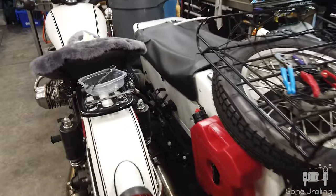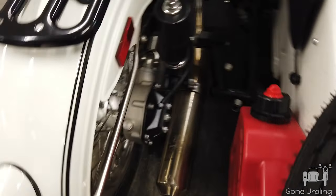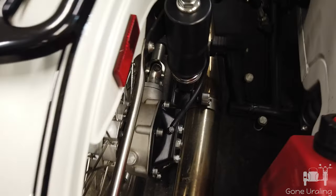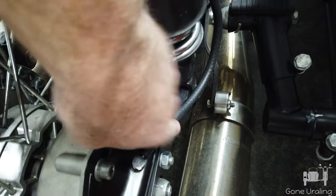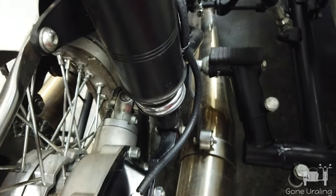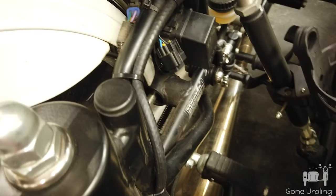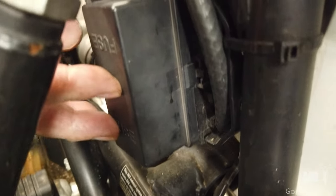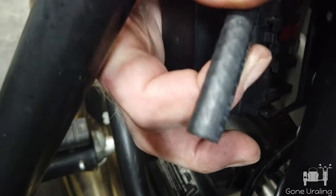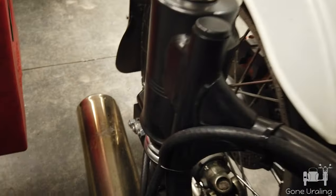So let me route the hose on my retro, and then I'll bring you back and show you what I decided to do. I thought about running it up along this rail and out under the tag, but that just looked ugly, a little bit too far. So I opted instead to come off this direction — there's enough play here for the swing arm to go, and I left some excess. On the retro I just opted to drop it right in front of the fuse box, which is attached on a bracket. I just left a little excess — enough that it would tuck. And that's the solution I have.